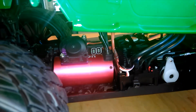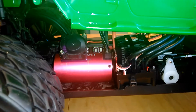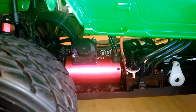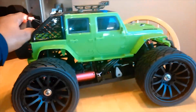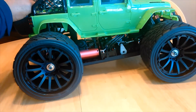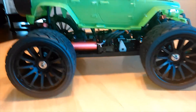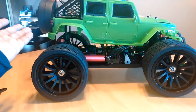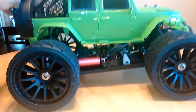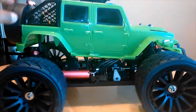You can hear those fans going — there's a fan on the motor and the ESC fan. It's a 150 amp ESC running a 1900kv motor. Now she's ready to squat when she takes off. Right now I've got it dropped in the front, but I'm going to even it out. I thought about keeping it a little jacked up in the back, but I know she's gonna squat big time and I want to have that clearance.